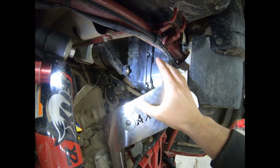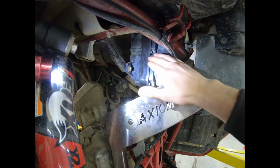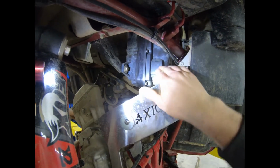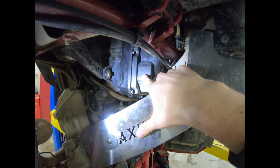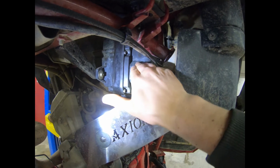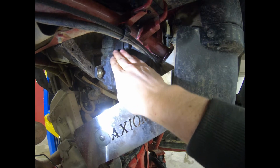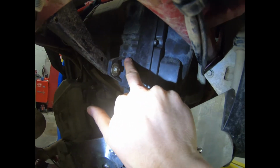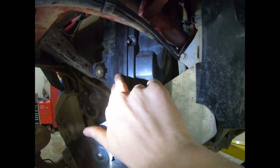Now it is kind of a pain in the butt, but it is doable. After you move both the spacer and the hat together, trying to get the hat to sit up in its neutral position, once you get this hat up into this position, you can move the spacer around just fine. So you get the hat up there, you put the spacer in, I went ahead and clicked the spacer into the box itself first. And then I took the hat and clicked it into the spacer.